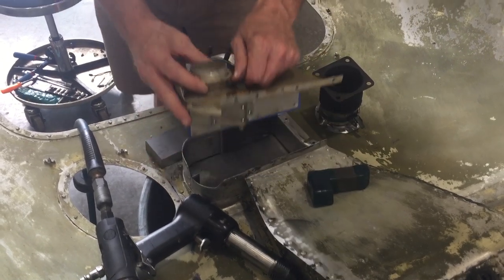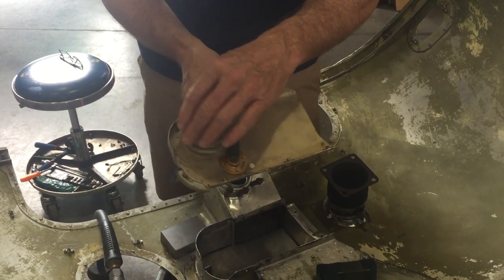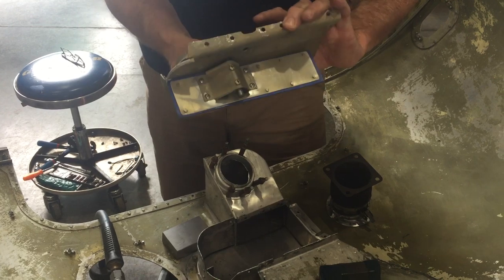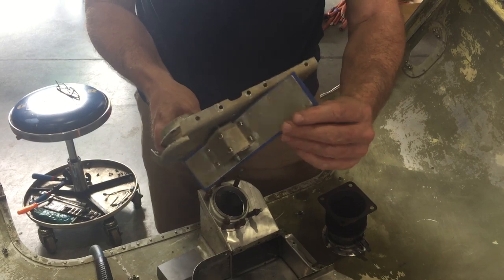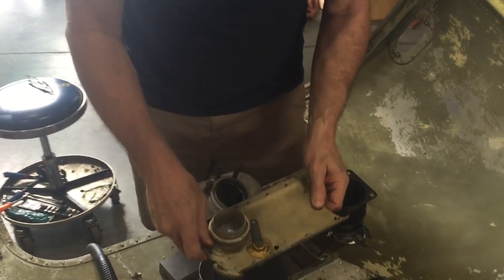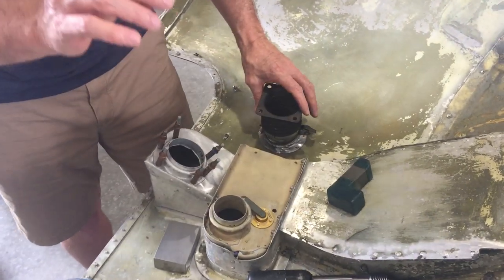The heated air source has its own intake hole which runs off the exhaust manifold — that is how the carb heat works. What was rebuilt was this piece: it was all sandblasted and cleaned up to a nice smooth surface, then rebuilt with a new gasket. Everything is nice and smooth and works perfectly.